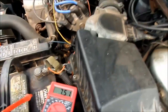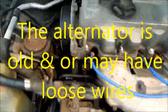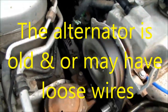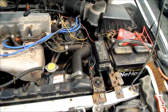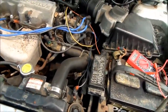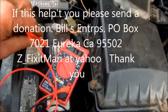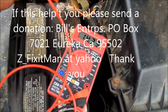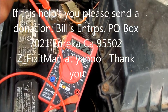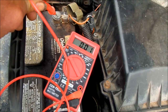What has probably happened is some of the contacts in the alternator won't kick in until the car is revved a little bit. Ideally, what I'm going to do is put a voltmeter inside my car to watch the voltage and see exactly what it's doing.